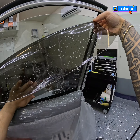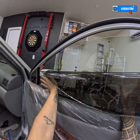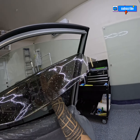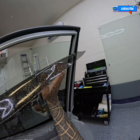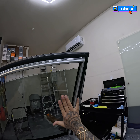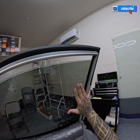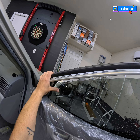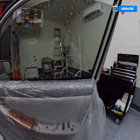Slowly work the side closest to the windshield — as you can see the other end of it is on the glass now, and the soapy water is going to give me the ability to work the film down slowly. When you get closer to having the film where it needs to be, you're going to have to tuck in that top corner. Once the film is installed, line up your top edge and leave a very small light gap. It does take time and lots of practice, so you probably won't get it on your first try — the smoother your install goes, the cleaner the job's going to look at the end.